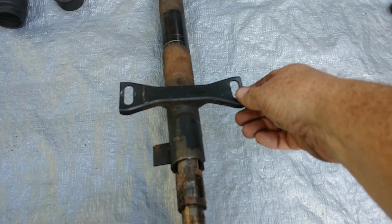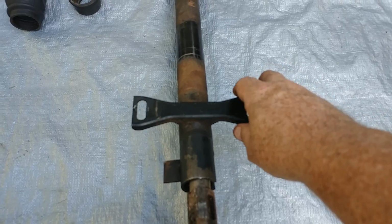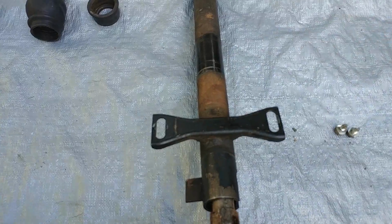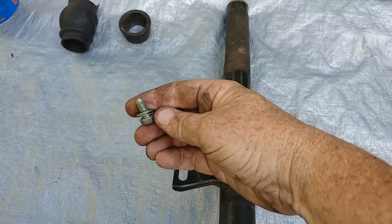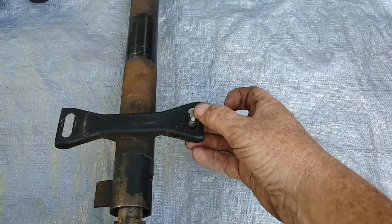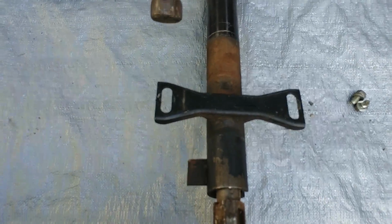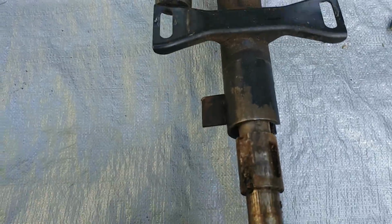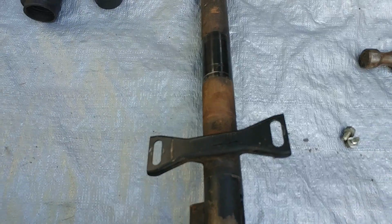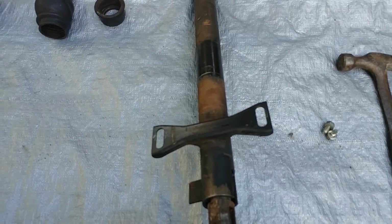Alright everybody, we're back on the example away from the car, the cutaway from the car. This is what I was talking about. I was trying to explain to you that these little 13 millimeter screws go up in here. That's why you take your ratchet. This would be under the dashboard. And all I did was I took my hammer, once I undid those, and I just tapped them out, and it walked the whole entire steering shaft out of the car. And literally that's all you do.